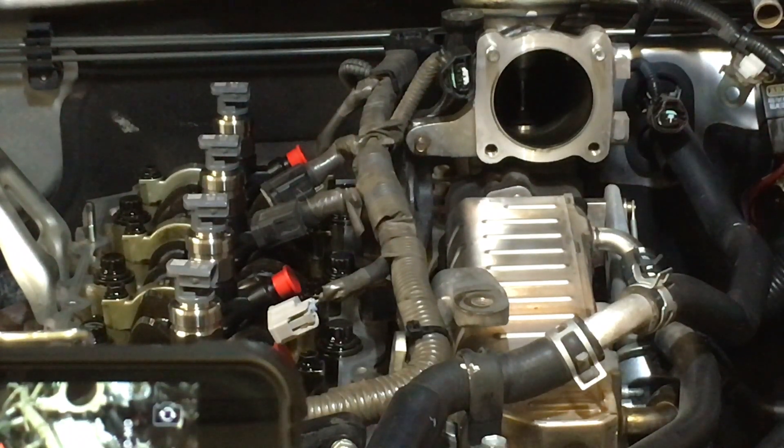I just incorporated the EGR into this video because I had it there to show you. And we can look at a set of injectors here — beautiful things. They're just sitting in place, not even pushed all the way down yet. We've cleaned the ports, we've dropped the washers in, we're sitting the injectors in place. Don't try and attempt this on your own unless you know what you're doing or you've watched the videos in the VIP group. I'll just remind you again — September 2009 roughly is where they changed for the Hiluxes. From 2009 onwards Hilux, the injectors change — they're different injectors.